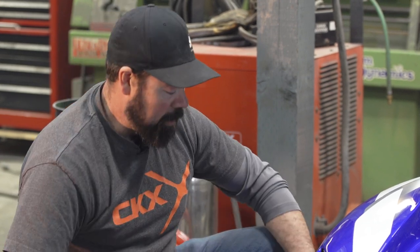Because I replaced so much on the front of the suspension of this SRX, I've kind of lost the center line of the chassis. To find it again, I've straightened up the handlebars so they're completely straight across the chassis, and I'm setting from a center line using this aluminum bar lined up on the track at the back. Looking for one-eighth inch total toe out, I'll measure at the front and back of the ski to that aluminum bar, with the front of the ski one-sixteenth out — that gives me my one-eighth total when transferred to the other side.